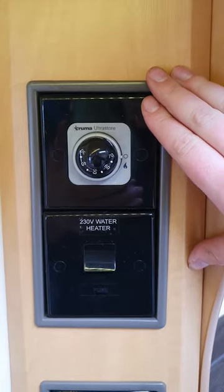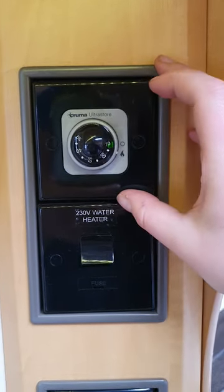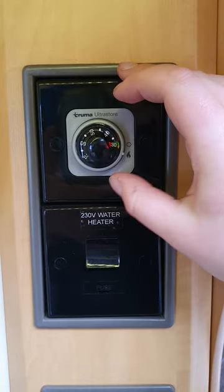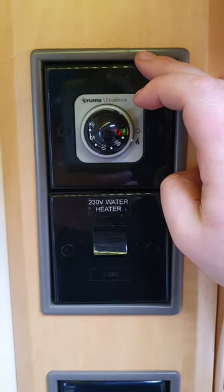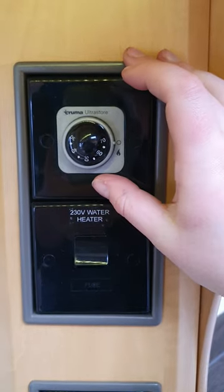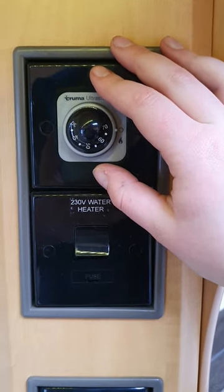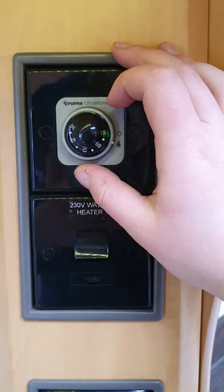Up above your kitchen sink here, these are the controls for your water heater. To run your water heater on gas, you'll want to flick it to the little flame. You'll get the green light and you'll hear a click underneath the front seat — that's your water heater trying to ignite. The inside dial is your temperature, so you've got 30 right around to 70. If a red light comes up, that means the water heater has failed to ignite on gas. Turn that off, go and check your gas bottles are connected properly and still have enough gas, and also check that the travel cover on the outside has been removed. Once you've checked those three things, you can come inside, turn this back on and it should be good to go.